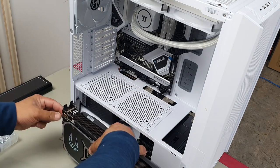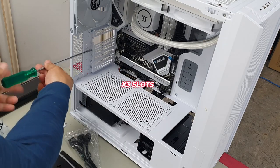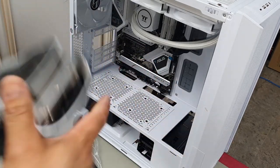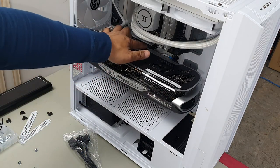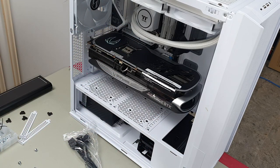Okay, we'll take out all these graphics card plugs. These 40 series cards are absolutely huge. We pull off our PCIe x16 slot protector, line it up, make sure everything is lined up. That's it. You hear that click? That ensures that your tab here has clicked the graphics card into place.